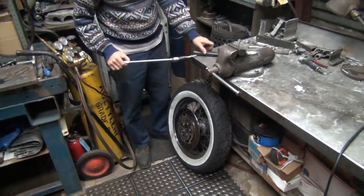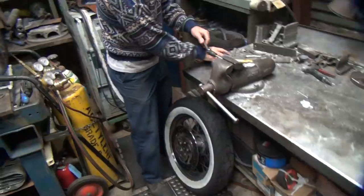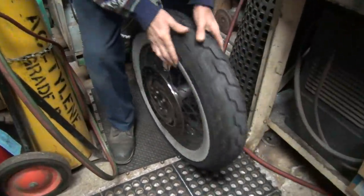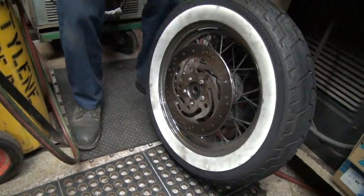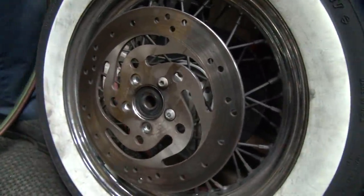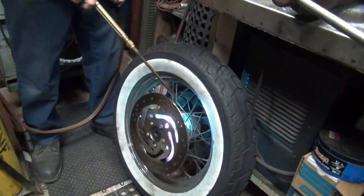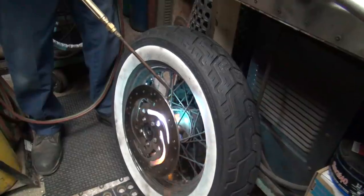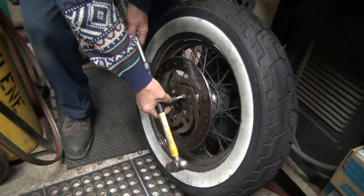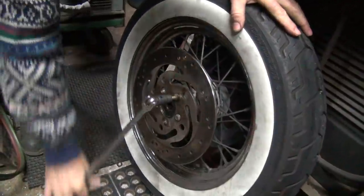All right. You missed the first three. So we preheated the whole hub a little bit. And then we heat up right where your bolt is quite a bit in one spot to melt the Loctite. Loctite melts at 350. See, maybe that's what I was doing wrong, was trying to heat it from the front side, from the bolt head, instead of the hub, where the Loctite is.